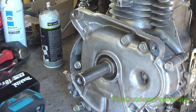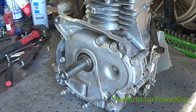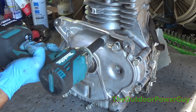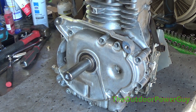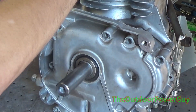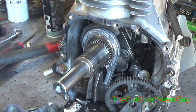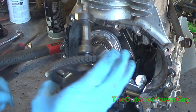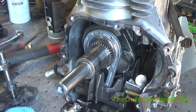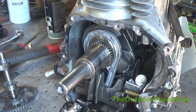Now we're going to take the oil pan — or sump cover — off the engine. This engine's build date is September 2022, and it's June 2023 when I did this video. Nothing on this engine is rusted or discolored. But immediately when I crack the pan loose, what comes out is what I refer to as gray paint — it's burnt engine oil with metal in it. There's a camshaft blown apart, and there are pieces of connecting rod, balancer, and cylinder wall in the engine. Looking at the crank journal, there is metal transfer, which indicates a lack of lubrication.